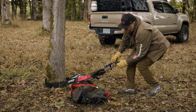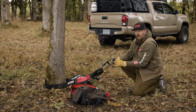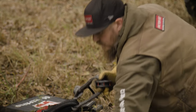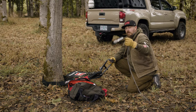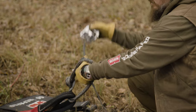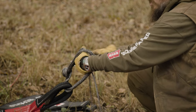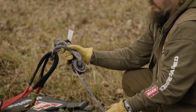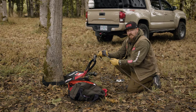Now that you have this set up, your pulley is ready to go. Simply grab the end of your winch line, even with your attachment on the end, feed it through the soft shackle opening, pull all the rope through, and let it fall down in between the pulley. It's that easy.